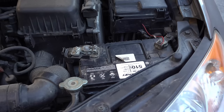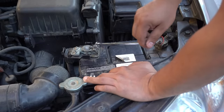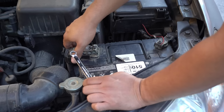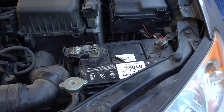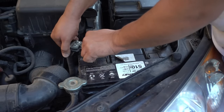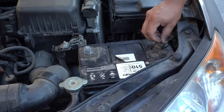The third method, which most people use, is simply disconnecting a battery terminal in order to turn off the warning light. I recommend carrying out the previous methods before doing this, since disconnecting the battery will erase any other configurations you have made — for example, stereo stations, clock time, equalization, or any other settings on the vehicle dashboard. Disconnect the terminal completely from the battery and wait at least five minutes before reconnecting, as this is the estimated time needed to completely erase the memory.